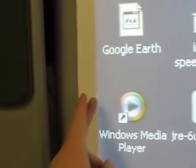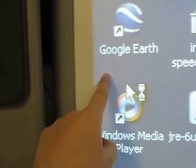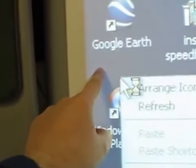The desktop takes a moment to appear here. Okay, so now here we are at the desktop, and as you can see, we are pushed in by an inch and a half on the left edge, and if I touch, the arrow is misaligned by about an inch and a half from where I'm touching. If we look over on the right edge of the screen, oh, that's interesting. The clock is clipped off. And that's because the video signal is pushed over too far.